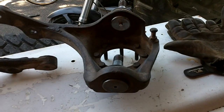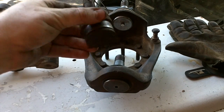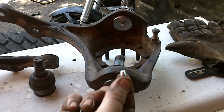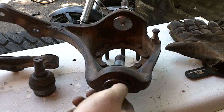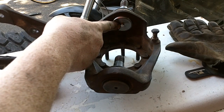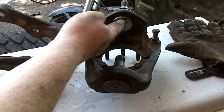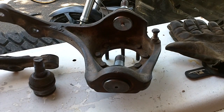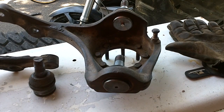The other thing you'll notice on the new ones — these are both serviceable ball joints. The old ones have no grease zerk fitting, but the new ones both have a hole in the bottom. Because this is on the bottom of your steering knuckle and can get torn off on a rock pretty easy, what you do is: put the zerk fitting in, grease them, then back it out and put a small plug bolt on there with the same thread. A lot of times where that axle goes through, you don't have the clearance to keep a zerk fitting down there, and certainly on the bottom you'd get it knocked off on a rock or stump. So basically you keep those plugs around, pull out the little bolt, grease them, and put the bolt back.